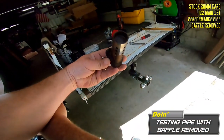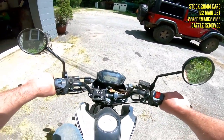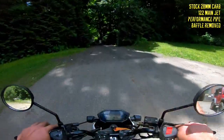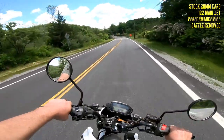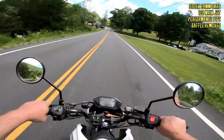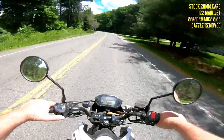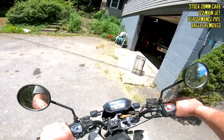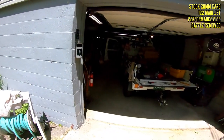I'm going to try unbaffled. There is a lot of air coming out of this thing - like a lot of air. My god, that's so loud. I wonder if it's a spark plug or a coil. It actually has more power with that baffle in it at this point, which means I could probably jet it up. But I think I'm just going to put the baffle in it. That's so loud, it's obnoxious - it's too loud.